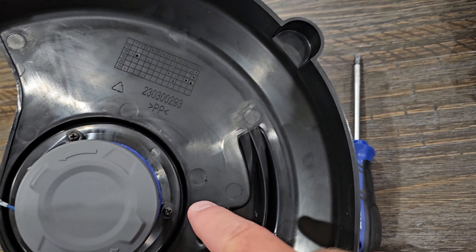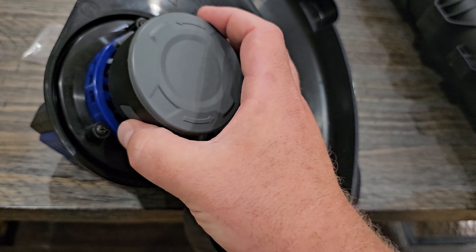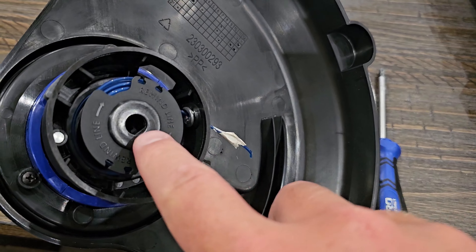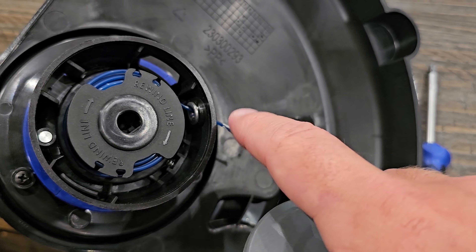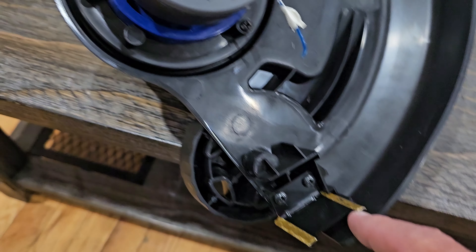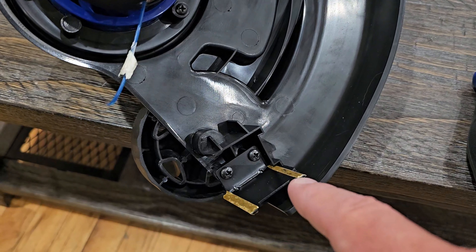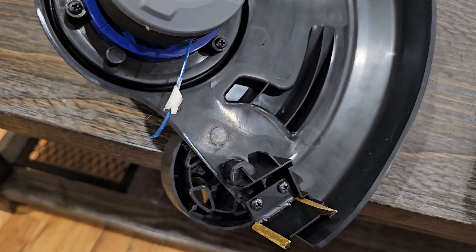There's a button on each side of the top part — push them in together and it lets you take the spool cover off, but be careful the middle doesn't spring out because that's where your cord is wound up. It shows you which way to wind the line, which is important. Once wound, you stick the line through the hole and snap the cover back on. There are also two blade covers over the cutting blades — these make sure the line doesn't come out too far. Once it reaches that length and swings around it hits the blades and gets cut. The covers will wear off themselves as the string rotates.